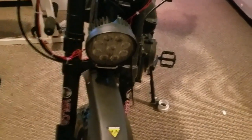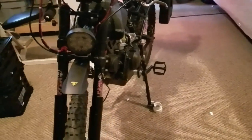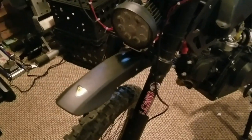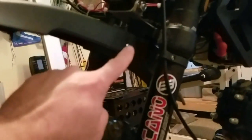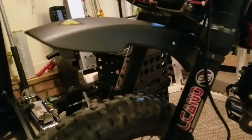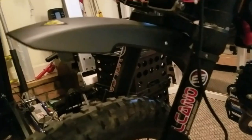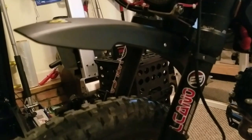I got the headlight option — that's a must-have. If you don't have the headlight, you'll have a hard time driving in the mornings and evenings and you won't get it registered. I also put a fender kit on, straight off eBay, recommended by another Motoped user. We used the original mounting post into the lower tube and riveted each side. If you try to ride without the fender, anything wet — any puddle, any sand — will end up on your helmet and jacket.